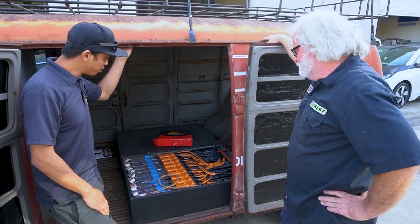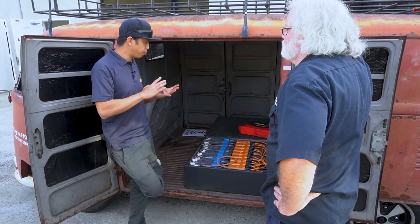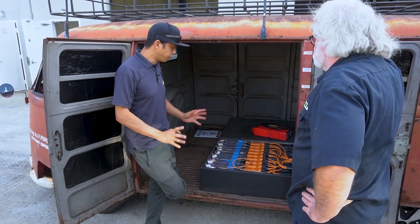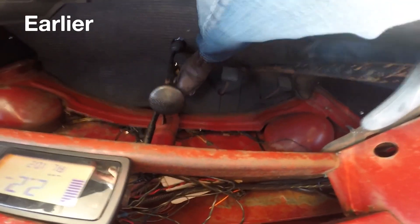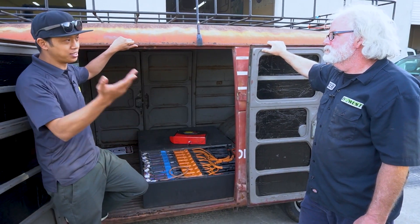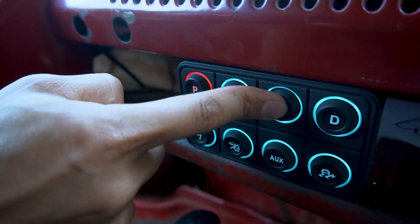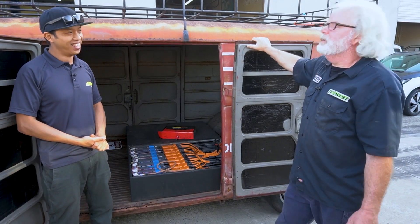You guys made a lot of improvements on our little bus. Some features we added: hill hold. One of the things Kirk talked about in his first driving impression was pedal bounce. I've got four different performance modes — mostly throttle response. Level one is the softest, performance level four is super responsive. We've done a lot of filtering with the torque control and the pedal control. Especially with this bus and its suspension, it's hard to maintain a good throttle input, so it dampens that out — very smooth ride. And like those guys at the fuel station who drive away with the fuel nozzle still in, when J1772 is plugged in, it disables any torque. It won't let you drive away plugged into your wall — that's gonna save some body work.